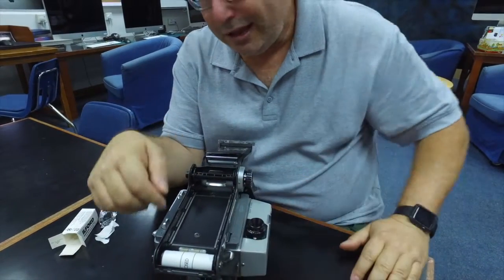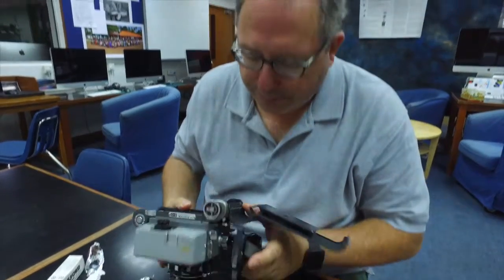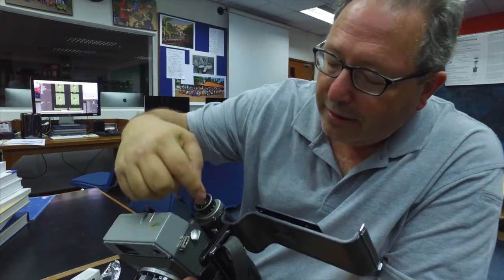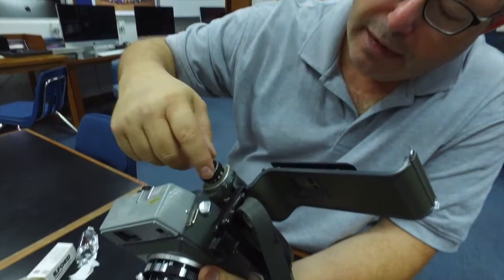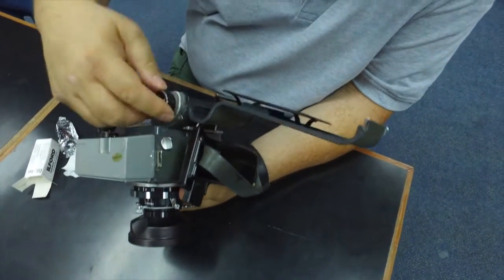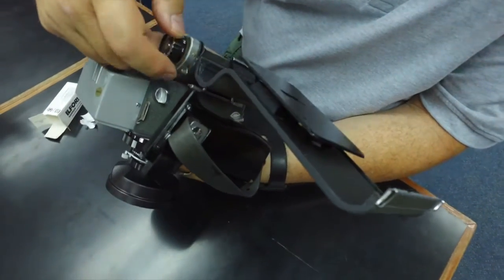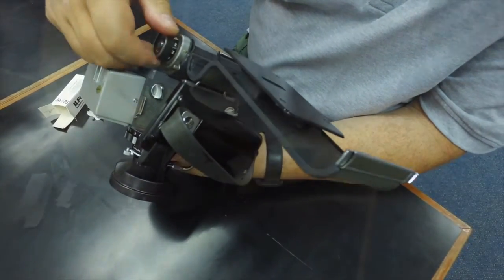Now, you're supposed to take this over here and put it in the slot and start winding it in place. Here's where the complication comes. These old cameras have little quirks, and this one is that if I move this little latch right here, it starts to take up. So I need to find out. That arrow, as I move this, is starting to move. Okay, as I roll through every one of my numbers, it locks at number 1. I unlock it and move it to number 2, and so on until I get through format.